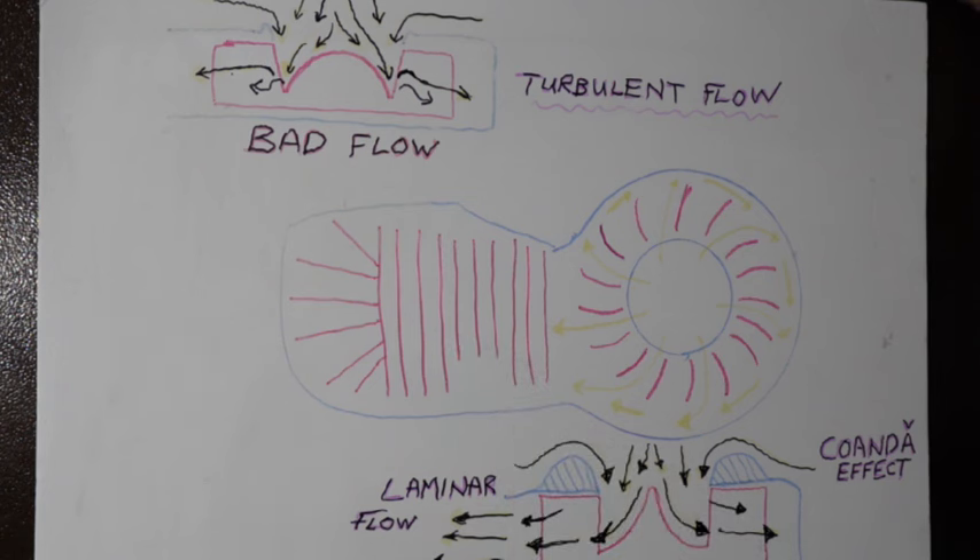The cylinder head is the most important part we want to cool — that is where our heat is generated. My design uses the Coanda effect to the greatest effect possible. My cylinder head cowlings have a bell mouth on them — a Venturi. The Coanda effect means that air will flow across the face and stick to it, increasing air speed. This bell mouth increases the air speed going into the fan, so you can get more cubic feet per minute going over your engine. The cone shape in the middle also uses the Coanda effect — it's specifically shaped so the air sticks to that curve.